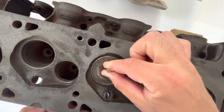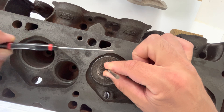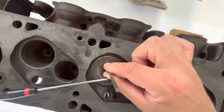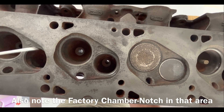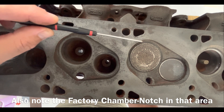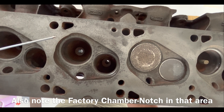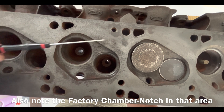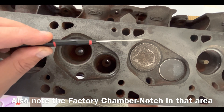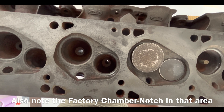Instead of being upright, it's angled away from the cylinder side wall and away from the short turn, basically trying to direct its way to the center. You can see it physically - it starts to unshroud that whole section there, traveling outwards towards the center. You can see the distance moving apart as the valve lifts, and when it closes back in that distance starts to tighten up. That's basically the canted valve in these Cleveland heads.